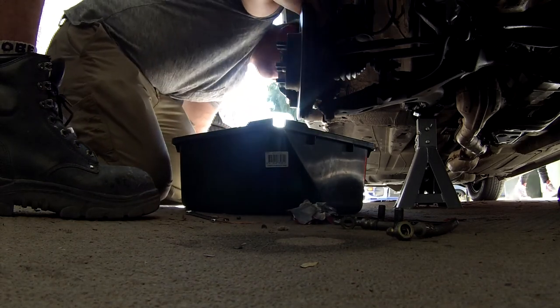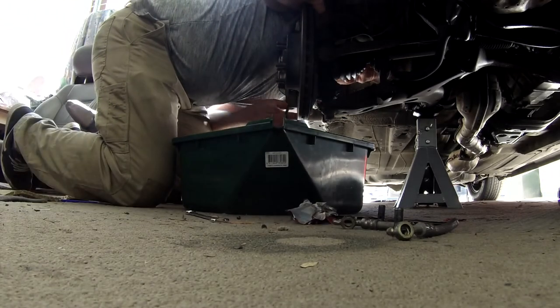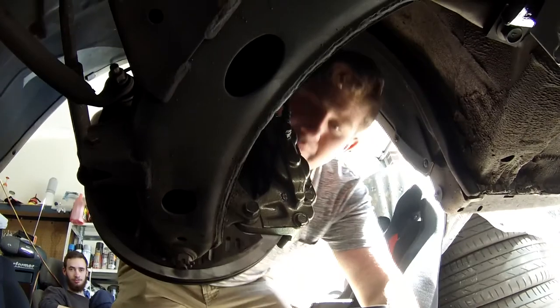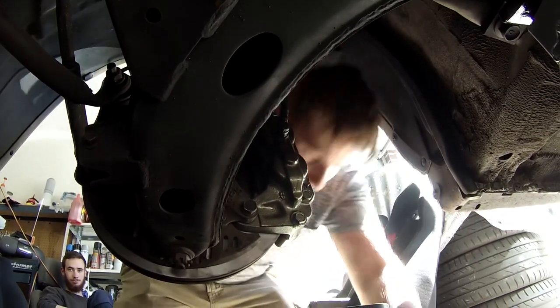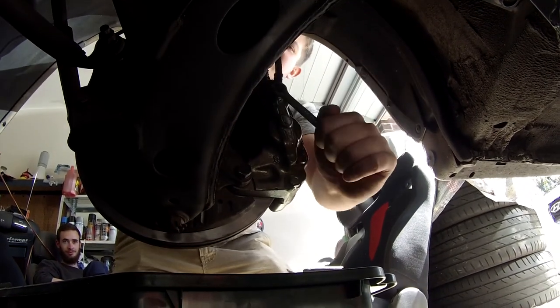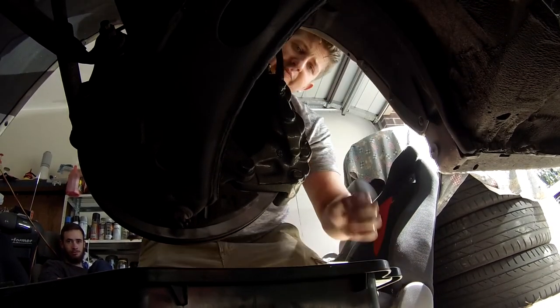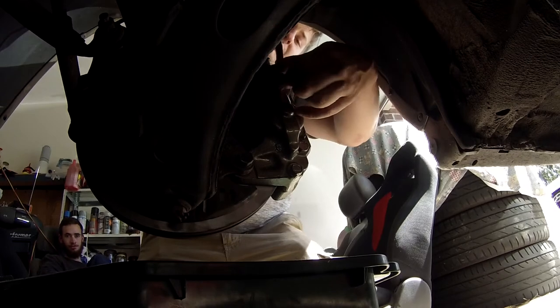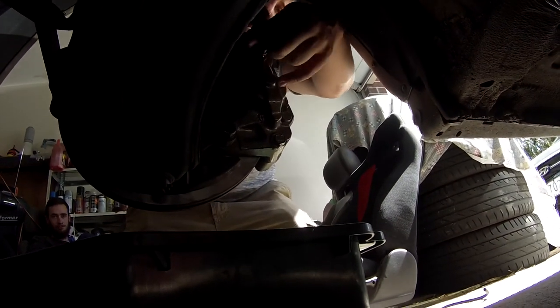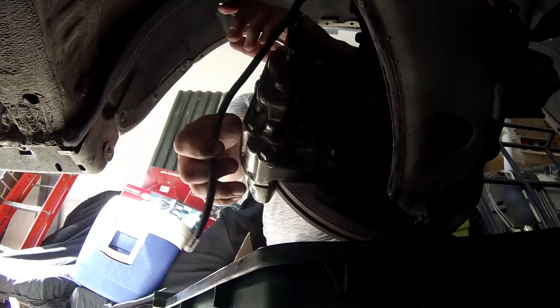We're leaking brake fluid. Oh, if we can work it out. Still leaking. The paint build-up? Yeah, paint build-up just made the crush washer not seat. Just peel it off. Already have.